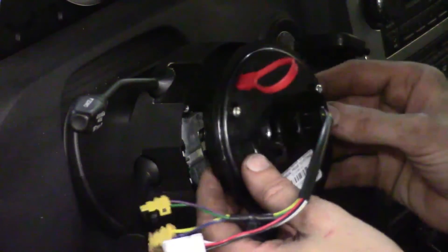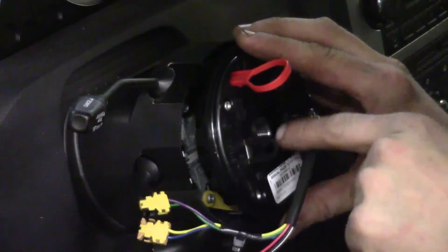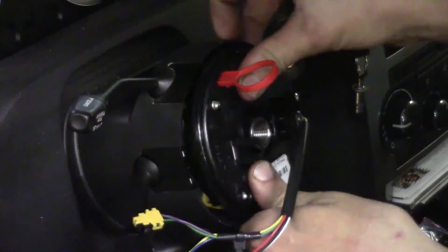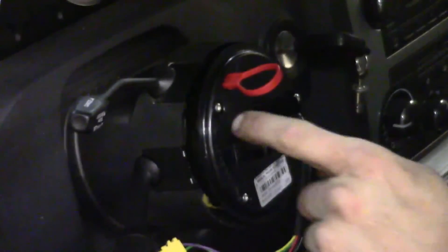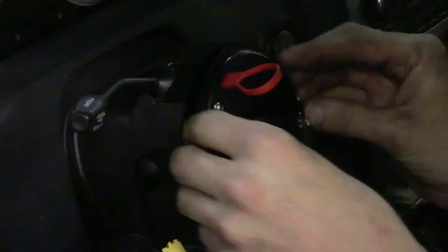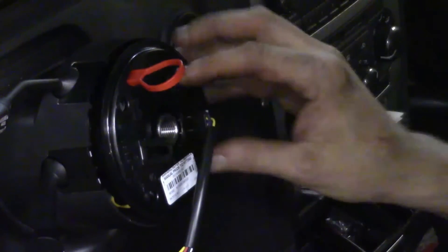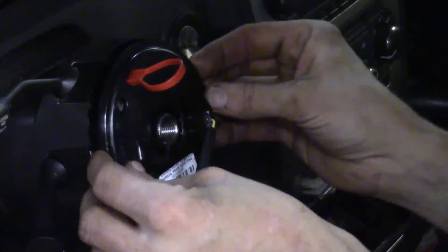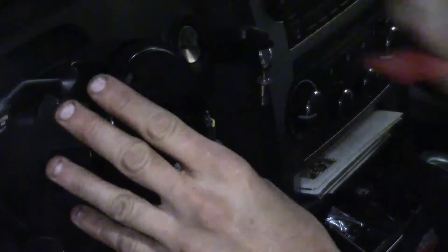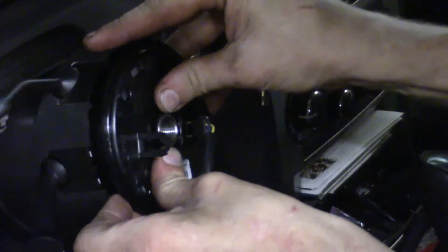Get it started, put it over the steering column, and then start pressing down until it's fully seated. Look at all your fasteners and where they should line up — everything should still be straight up. Once it fully snaps in place, tighten down the three torx screws. Tightening down the last of the three torx screws now — everything's fully seated. Go ahead and make sure it looks fully seated, then pull that red lock off since we no longer need it. Check that everything moves smoothly — as long as it moves fully freely, we're good to go.